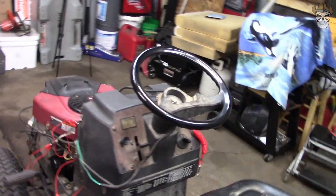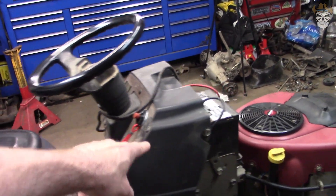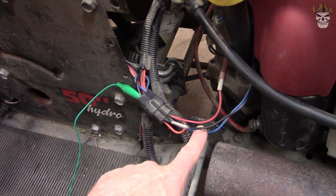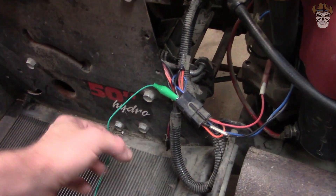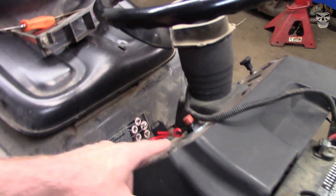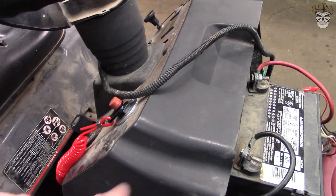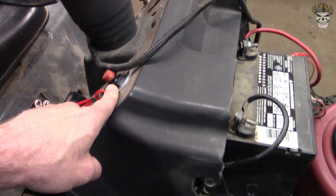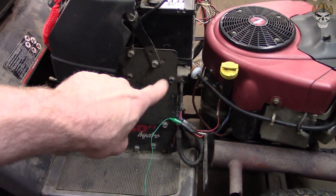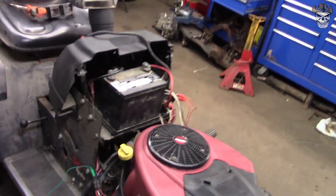I already kind of got the tether half in here - I'm going to find a better place to mount it but for today I'm just going to mount it there. All that's going to involve for the wiring is hooking up to this black wire, which grounds out your coils. This switch is normally closed, so when I unplug it it will close the circuit and create a loop, and with it plugged in it will break that. All I need to do is hook the wire from the battery to that and crimp into the black wire somewhere down there so the key and the tether will both work.